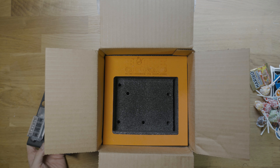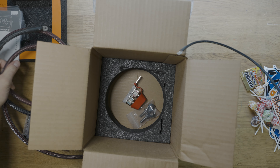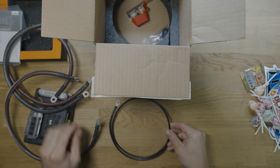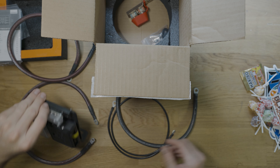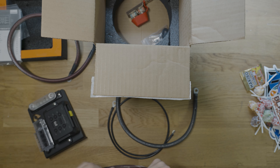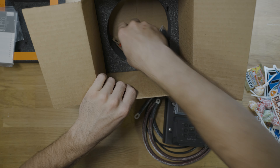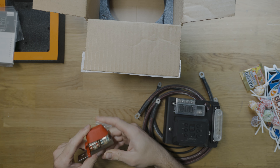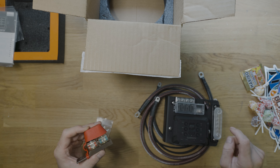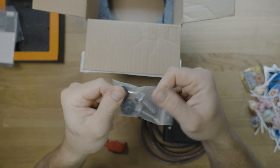The packaging and presentation on this is really nice. We've got three power cables — a ground cable and two power cables — and then what looks like a communication cable or another ground. I think this is the grounding cable for the Garmin and this is the grounding cable for the grounding bar. So that checks out. Then we've got two power cables: one for the Garmin and one for the fuse block. Last but not least, we have a terminal fuse block with two really high output fuses — 125 amps for the Garmin and 50 amps for the fuse box — plus two bolts and spacers.